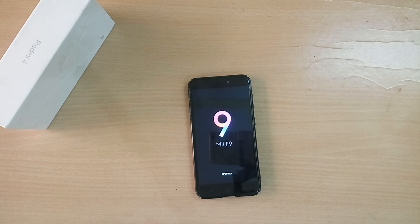By the way, this is the most stable MIUI 9 available for the Redmi 4 right now. Also, this is the only MIUI 9 available for the Redmi 4 that can be flashed through TWRP recovery, because all other leaked MIUI 9 ROMs are fastboot ROMs — you need to flash them via fastboot mode, which means you will lose all the data in your internal storage. So overall, this is the most practical and most stable MIUI 9 ROM for the Redmi 4.